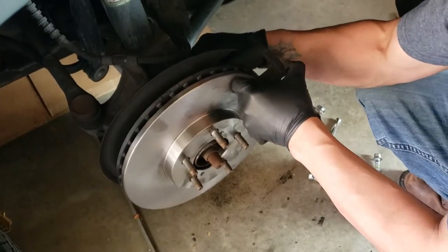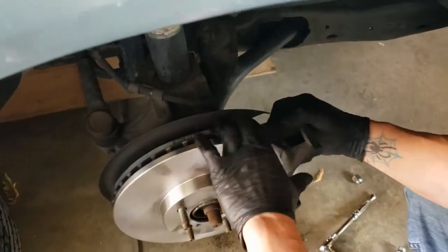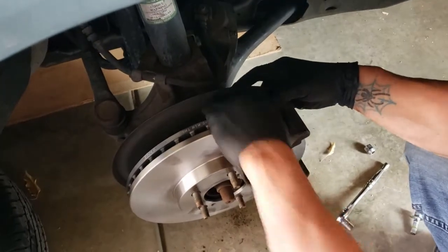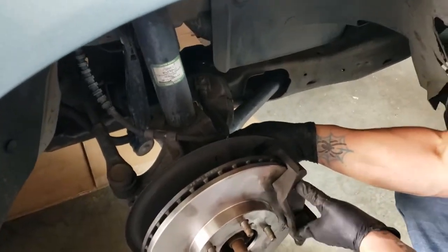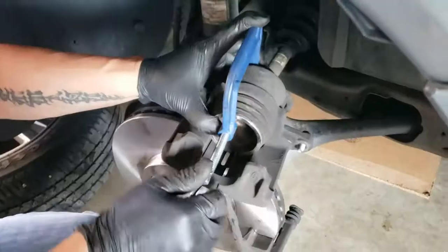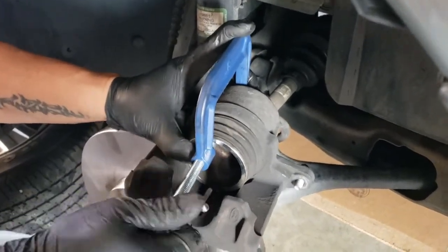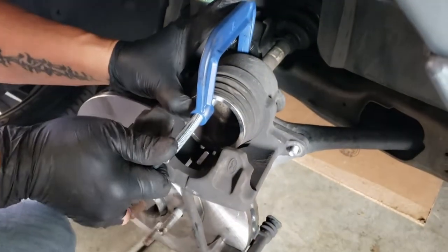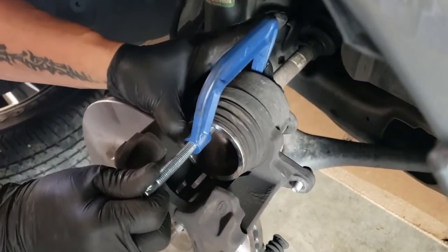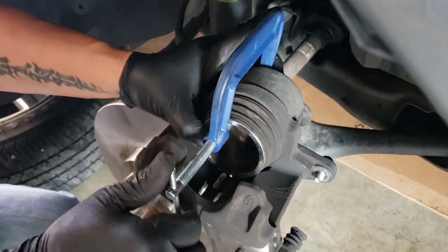We will do the other side. Here's the passenger side — we've got the new rotors on. Go ahead and get the caliper bracket with the 16 millimeter bolts in the back. Get those lined up so you can put those down. Once you have those, grab the top of the caliper, put the top caliper pin in, and then you can move to the brake pads. Once your caliper bolts are in place, you do need to reset this piston or the pads actually won't fit in there. Use a C-clamp or something to squeeze that piston down — it takes a little bit of time if you don't have the perfect tools. Once that piston is all the way pushed down, we can go ahead and put our brake pads in.